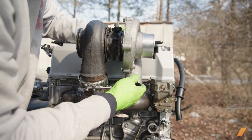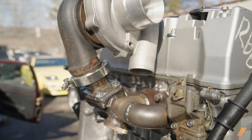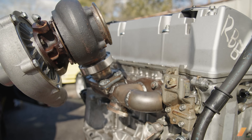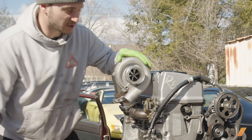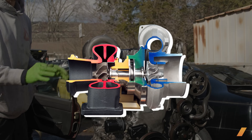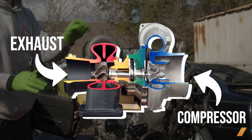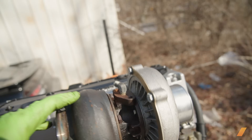That's exactly where I started — mounting the turbo, which for me was very easy because it has a V-band connection to the turbo manifold. Just like that, we have a turbo mounted. This is all loose right here because I want to be able to clock it. Clocking a turbo refers to rotating its exhaust and compressor housings to optimize its fit and function within a specific engine application.